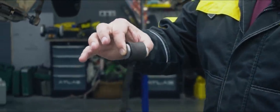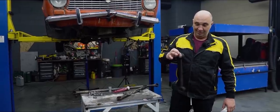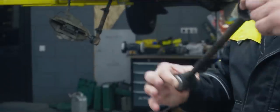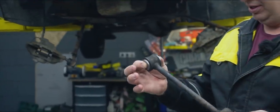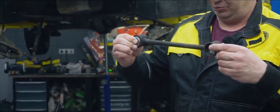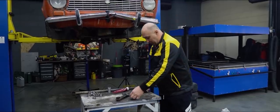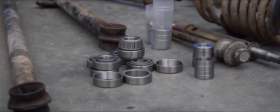The bearings do differ from bushings in operation - there is going to be zero resistance when the link goes up and down. A normal bushing gets twisted, but here there's simply nothing to twist. I gather it's going to be pretty awesome on these bearings. So that covers the short links.